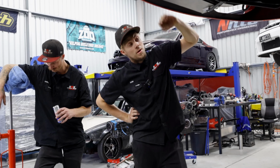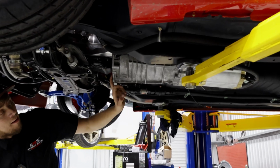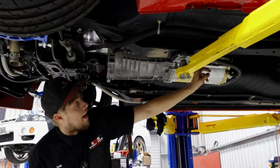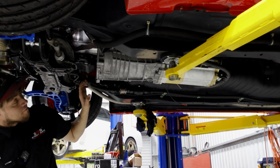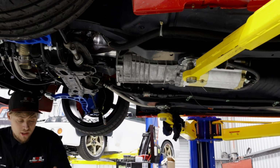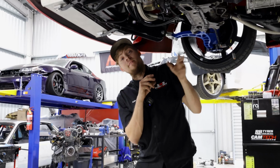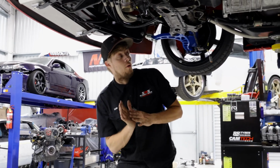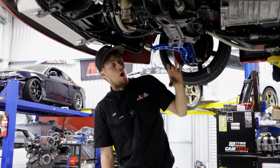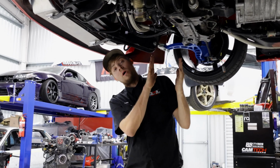So we got it in the car, we got it mounted up. It uses the front portion of a stock RB25 gearbox, and then obviously the sequential bolts onto the back of that. We've got the cross member made, just a few little things to finish on that. Usually these would run the stock front plate and then a stock fork and slave setup from a stock box. What we're in the process of getting done is making up a custom perch and sleeve kind of deal for where the front plate would bolt to the gearbox.